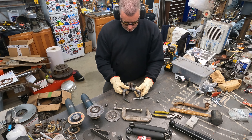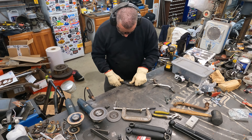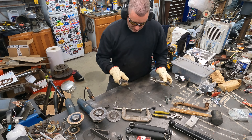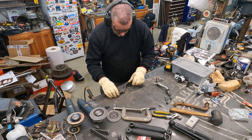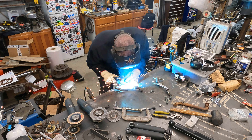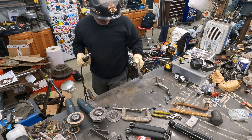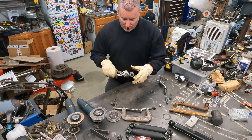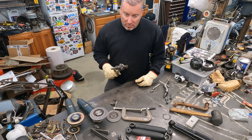Once I get this one cut and tacked together I won't burn it in to make it match that one perfectly yet until I go check it on the frame. I want to check it on the frame before I burn it completely in. If it works on the other side - which there shouldn't be any reason it wouldn't because there's no steering hoop and the fender brace is exactly the same - then I'll burn it in. But if it doesn't I can tweak it a little bit one way or another. No big deal.